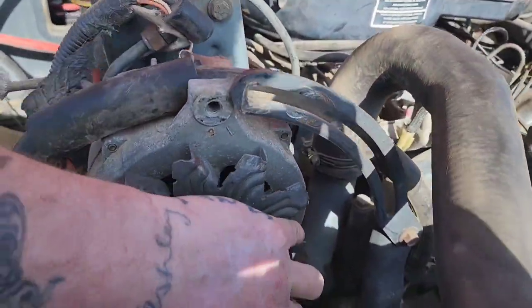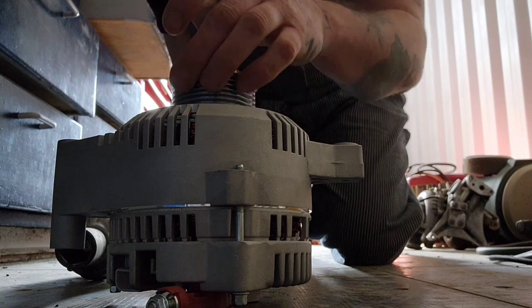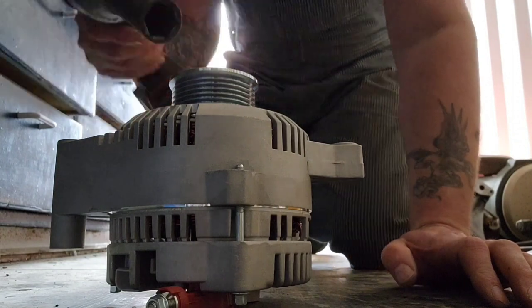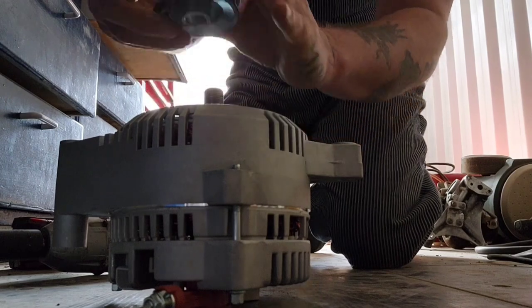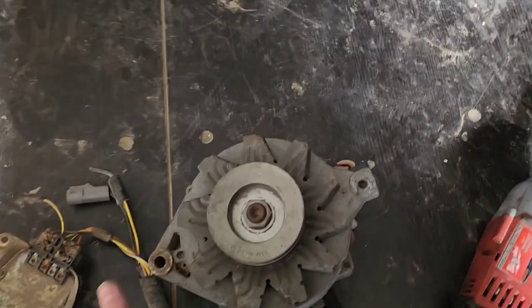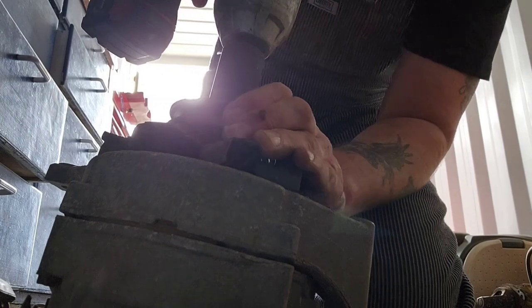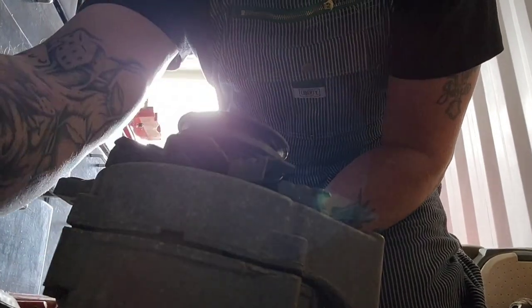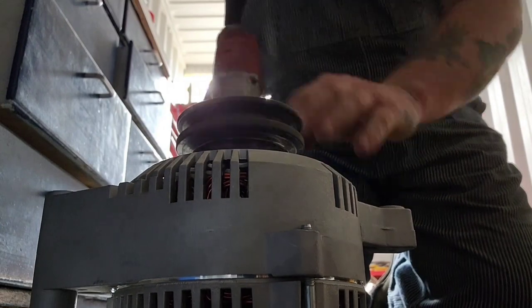The whole alternator should come up and out of there. Unfortunately, this brand new alternator comes with the wrong kind of pulley — we need a V-belt pulley and this is the groove style. I'm going to use my impact with a 24mm socket to back off the nut. That was quite easy and the pulley popped right off. I brought the old alternator into the shop to pull that V-belt pulley off — that old one put up a little more of a fight but the Milwaukee had it. Off with the bolt and pulley, and the pulley pulled right off. Got the pulley swapped over and tightened up.